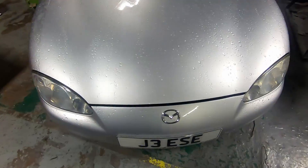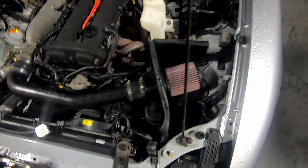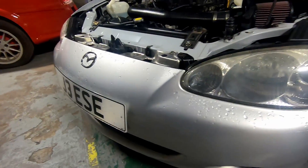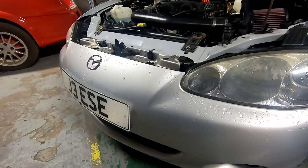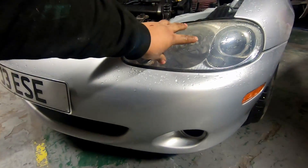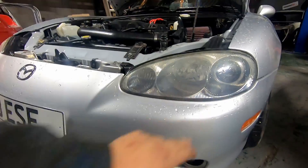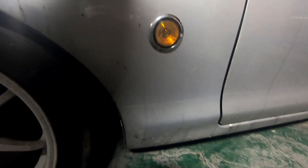Alright, those familiar with the MX-5 front bumper — if you've ever had to remove one, it's fairly straightforward. Loads of 10mm bolts along the top, there's a handful under here. We're actually going to leave these headlights in because the front bumper basically comes away from them and then goes back in against the headlight. There's a little kind of tab, and you'll see that. The side skirts — we're going to go with a removable option in case he needs to jack the car up, but that'll be clearer down the line when it comes to the big reveal video and when you see the whole thing in its entirety.